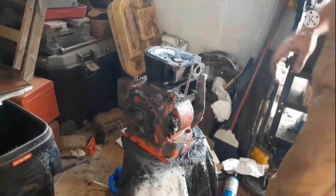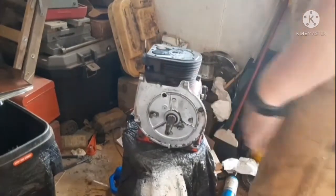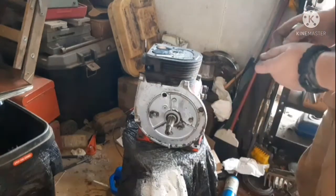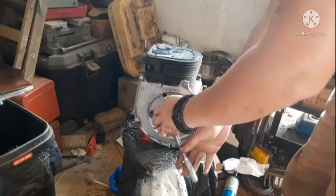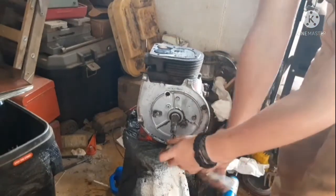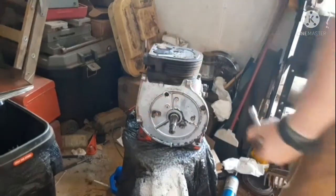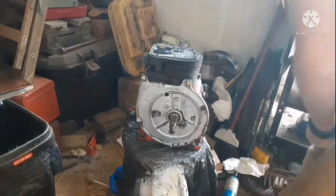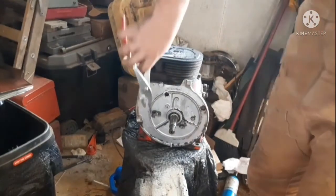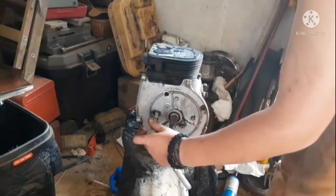Now, let's do something I don't want to do and remove this plate, because I need to get two gaskets behind it, because I want to make sure that this sucker doesn't leak. It's always good to run these off in kind of an X pattern, so you don't warp any of these old parts, because leaking gaskets suck. Ask me how I know. Why this thing's coming apart.